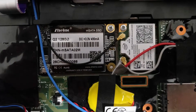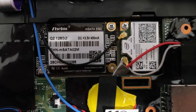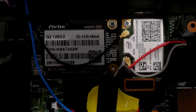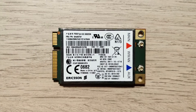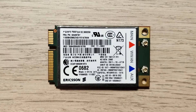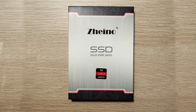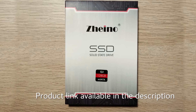Now, as most of you may know, the ThinkPad X220, which is the model I own, has two mini PCI Express slots. One accepts half-size devices and is usually reserved for the Wi-Fi chip, but the other accepts full-size devices. In this machine it was occupied by the Ericsson WWAN 3G and GPS module, which is basically useless today in the smartphone era where you can have your phone act as a mobile hotspot — and that's the device I'm going to replace with the mSATA SSD.